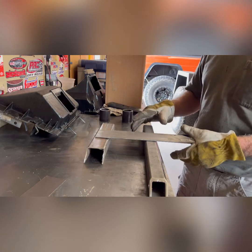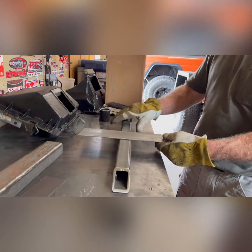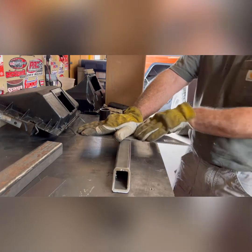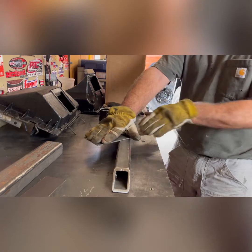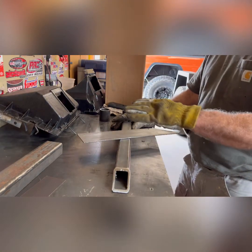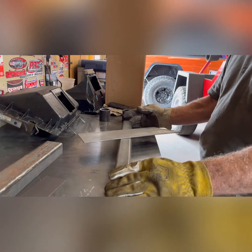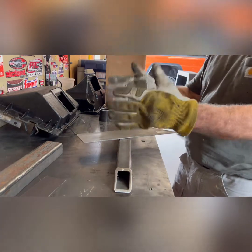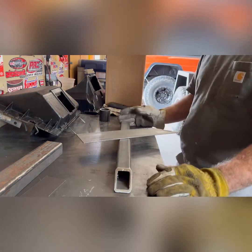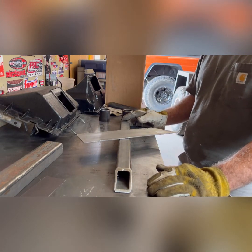So what I recommend is using one cross member. It mounts to the transmission and then has a offset of some sort to mount to the transfer case, and you're using one cross member. Frame starts flexing, the whole unit moves as one instead of doing one of these numbers. That could probably save you a whole bunch of money in a transmission.